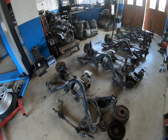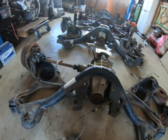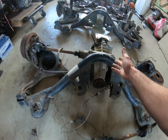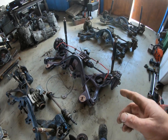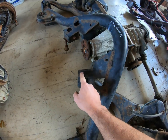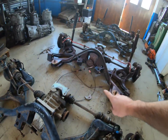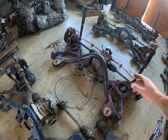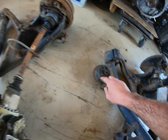Some of these subframes have the same core subframe part. The base models — Sierra 2-liter, 1.8, 1.6, etc. — will be exactly the same as each other. The Sierra XR 4x4 is a bit different, as evident from the serial number; the main visible difference is it lacks these two holes that the base models have. Another difference might be that the base spec ones have a welded-on exhaust bracket while the XR 4x4 doesn't — though it may have been cut off, so I'm not 100% certain.